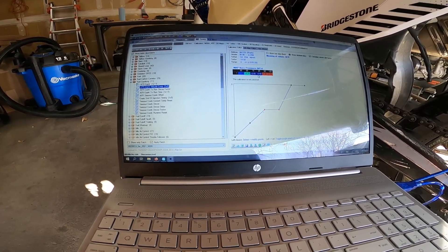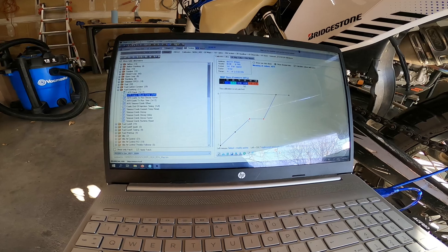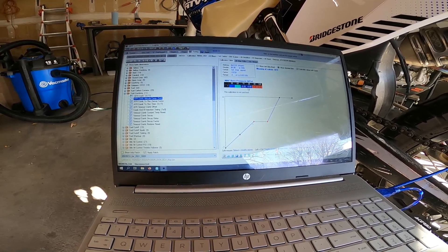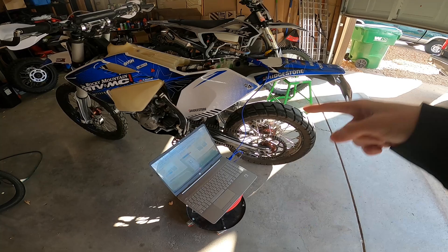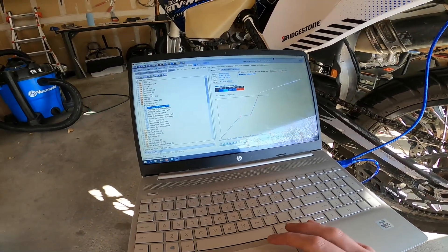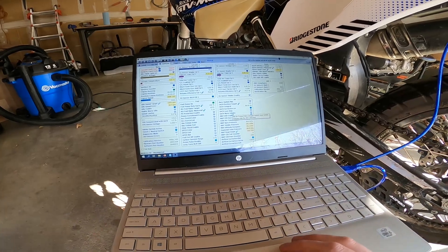I'm going to play with some settings and run through this same process again. I've got to wait for the bike to get cold because the issue only happens when it's cold. Once I did the second start it comes right alive. That's troubleshooting quick and dirty with HUD ECU Hacker and the cable, just looking at the ECU parameters. You don't need to go into the tuning at all — you can gather a lot of what's happening just from the dashboard to see what your bike is doing.